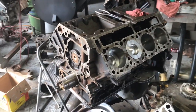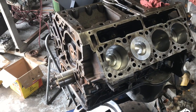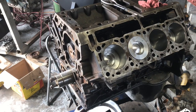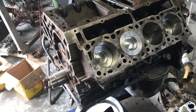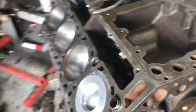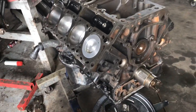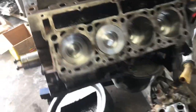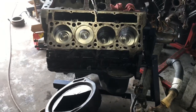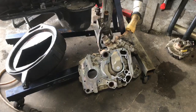This one here guys is a 6.4 Ford from — I believe it's a 2011-2012 Ford dually. Yesterday I did slap on those pistons, I didn't record it, sorry about that guys, but I went ahead and installed the pistons and the lifters are already in place. So I'm getting the heads ready and I'm gonna go ahead and slap those heads on, get those rockers in place, and so on and so forth. See how much of this one I can do today — clean out the timing cover yesterday.